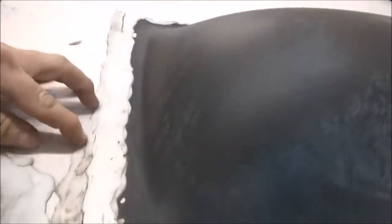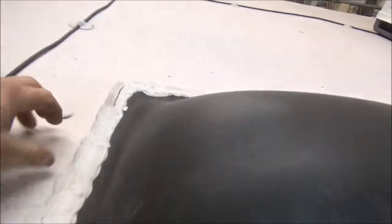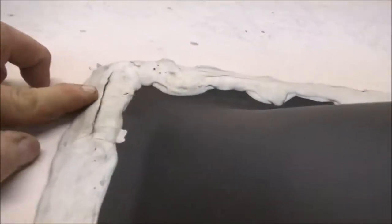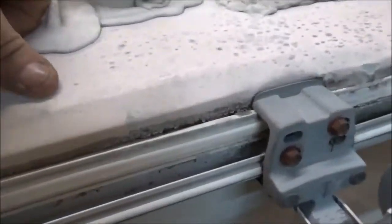That's because it's a sealant. Sealants do not work on roofs. You need something to adhere to it, something that will adhere and keep it from moving as much as it does, because these flex a lot. But you can see that pretty good gap, how it's right there. So that's definitely a leak. Let's see how much protection is on here. Looks like we got some issues here.